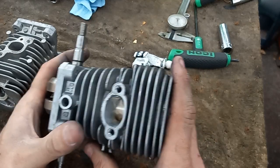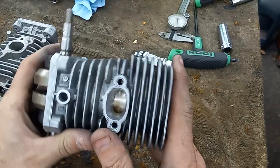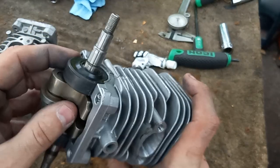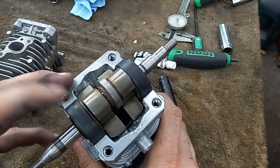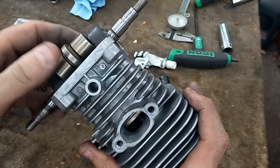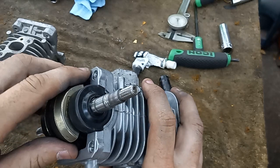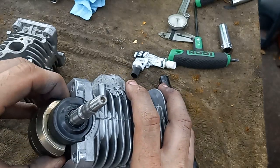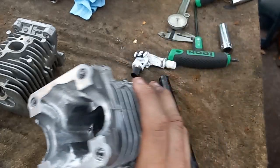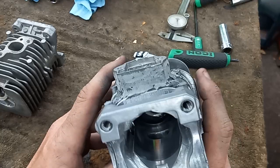And that's another thing that when you're porting saws, that's something you guys have to check on so they don't free port. But this is a bare aluminum bore, chrome piston and ring, so I don't know how long she's going to live. I don't know what it's going to get used, seals, and it's going to get gooped together. But the port work is done on it. I thought about welding up some of that combustion chamber, but I really can't do much about the squish, and I'm going to make this run on just regular old 87 anyway, so that's what I'm going to do with that.